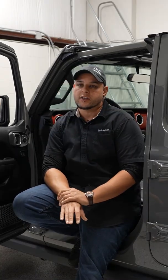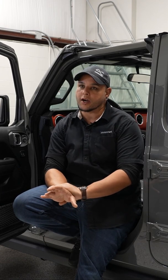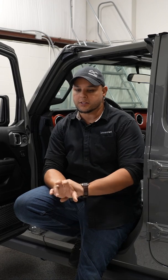All right, and staying on the theme of subwoofers, basically anything that you want to integrate into your system, if it's a factory system, you're going to need to add some kind of line output converter, something to get a signal that an aftermarket amplifier can use. Now, back in the day, the radios were very simple, the output was very simple, and just strapping on even a couple of RCAs to the speaker outputs on the factory unit would give you what an amplifier would need to see. Now there's a lot going on.